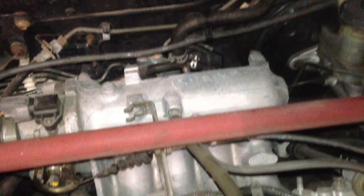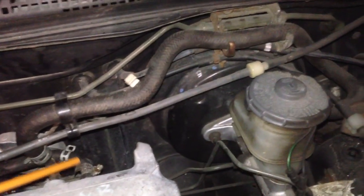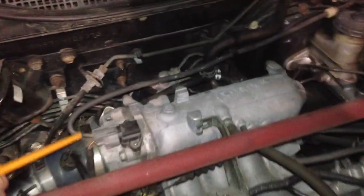If you want to use it for now, I guess it works. Not the best, but it works. You take this off and tee it into the same line as your evap solenoid. After that, just put a little rubber cap over the nozzle on the throttle body, or use some epoxy or tape or anything that covers it, just so that it doesn't have any vacuum leaks.